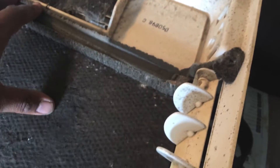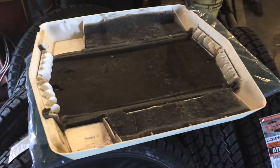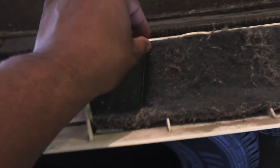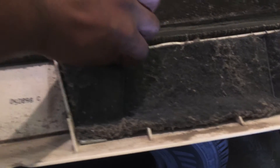Now this is basically what you've got — the AC filter frame here stays connected to the AC unit, and these are the two filters, which are absolutely disgusting. I've already washed them once since I've had this RV and they're very flimsy and not very useful. I'm going to put a much better one in there. But first we have to clean out this dirty unit — let's take it over to a compressor and get that done. There are some clips holding this piece of filter in here that I'm going to wiggle out.